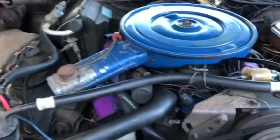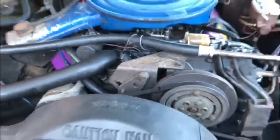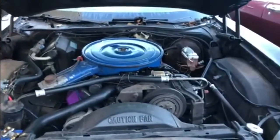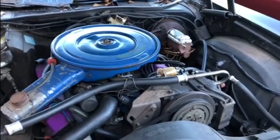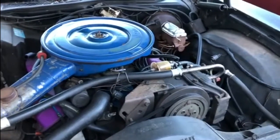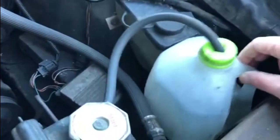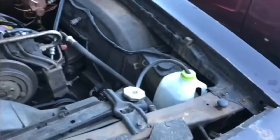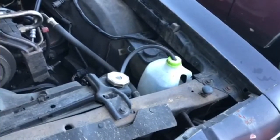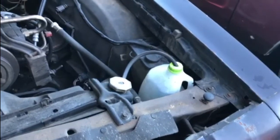The other thing I'd like to remove is this monstrosity — the air con system. It's connected and it still works, but the controls for the heater, air conditioning, and demisters don't work at the moment, so there's no heater and no demisters running. It may just be that the sliders are stuck because they haven't been used for so long — we'll pull that apart and have a look. There's also a plastic bottle being used as the radiator overflow, which is actually a genuine American milk bottle. I'll probably move it and put something else there.